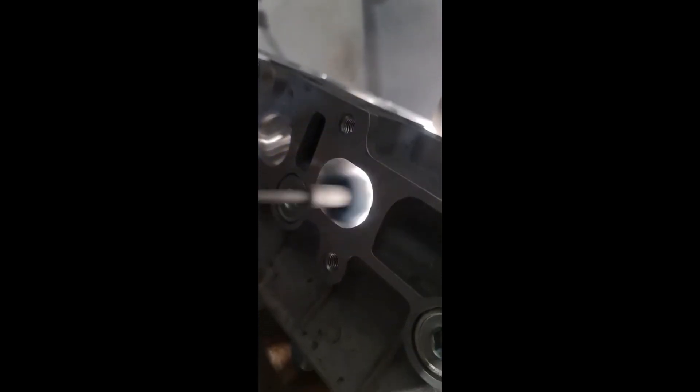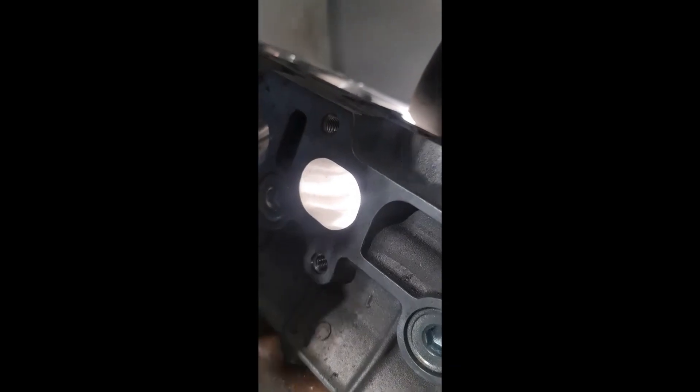Using the pads in the bowl can tend to round your valve seats, and as most would probably know, the whole radius valve seat style went out maybe 20 years ago — we need nice sharp edges on our valve seats now. There it is — it needs a little bit more work but that gives you the idea. We'll go right through front to back, finish all the polishing off, and it's pretty much ready to get some valve seats cut. And there it is — a nice polished finish on all the exhaust ports, and the shape has come up not too bad.